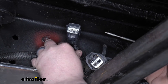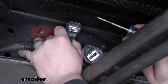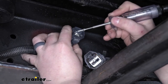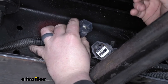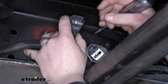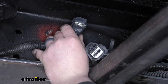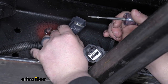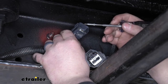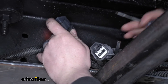Just to give you an example of how you would test your wiring: one plug is going to have four wires, the other one is going to have three. Right now I have my left turn signal on, so I take my buzzer and whenever I touch each terminal, I'm looking for a sound to match the light of our blinker. Right there — that's going to be our left turn, the yellow wire. I'm going to repeat that same process to find each individual wire: right turn, tail lights, ground, 12-volt power, reverse lights, and our brake output signal.